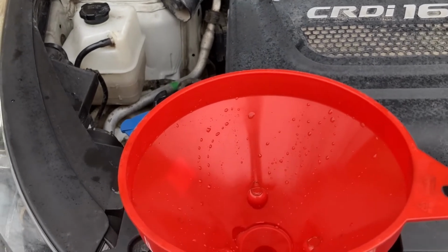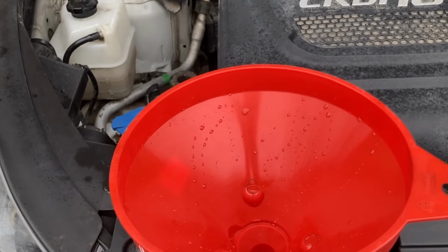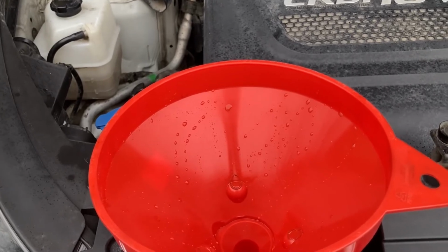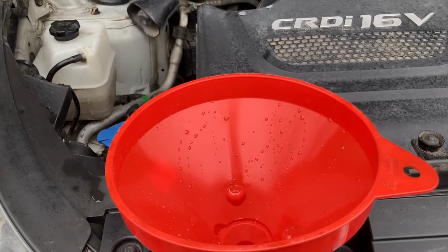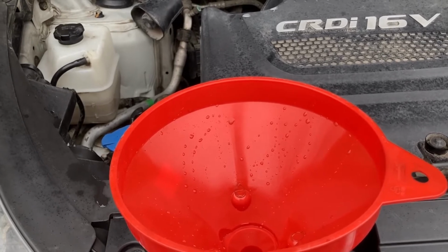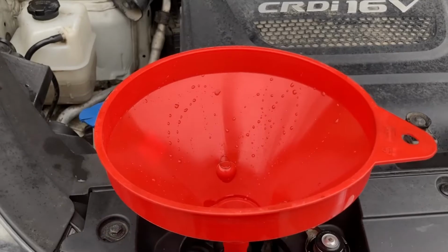And we do this now at the first step because I expect to have a good number of drain cycles, which should be sufficient time to drain the cleaning agent as well. And one last mention, make sure that you turn the heater inside the car to maximum in order to ensure that all the fluid circulates through the heater matrix or heat exchanger as well.